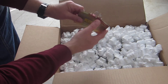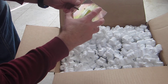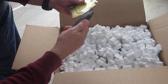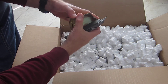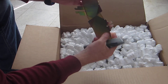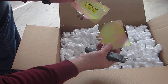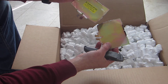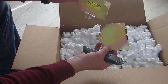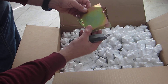Next it looks like some under-cylinder tins — they're taped together. This is a must on your engine; you've got to run some type of air channel underneath the cylinders to keep from getting hot spots. These are cut for 10mm studs, which is the size I'll be using on my engine. Based on the previous videos, I'll be using a CB Performance Rhino aluminum case cut for 10mm case savers, so these will take care of the under-cylinder cooling.